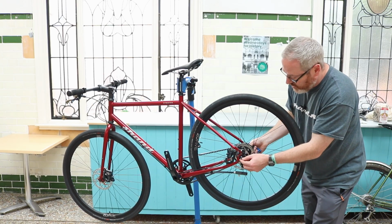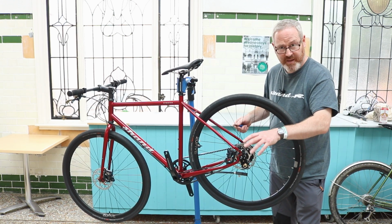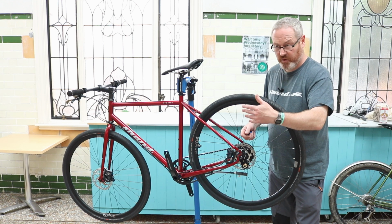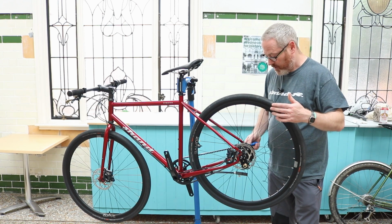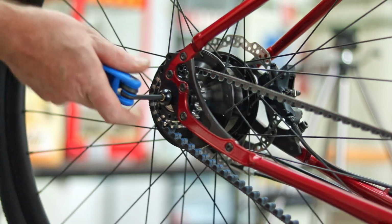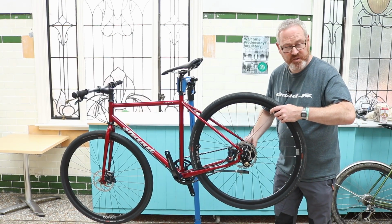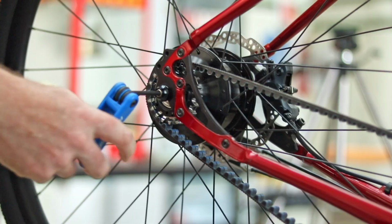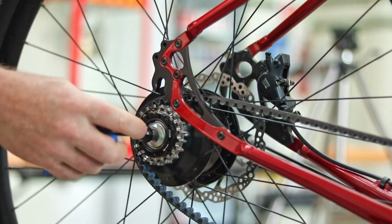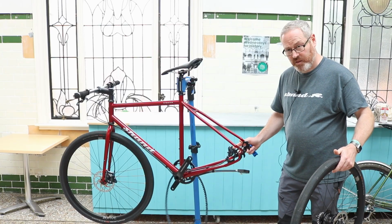On this bike here we have a quick release system, and we've used a secure 5mm Allen key so the wheel's more secure from being thieved or pinched and so forth. On this side of the bike, which we'll have a bit of a close-up in a minute for you, we're going to just undo the Allen key a couple of turns, which would be a normal quick release lever on a normal system, and then you will literally tap that, the wheel will drop, we're going to take the belt off, and that's taken the wheel out.